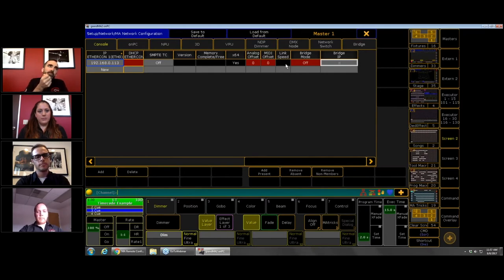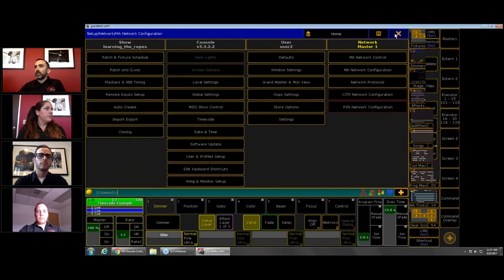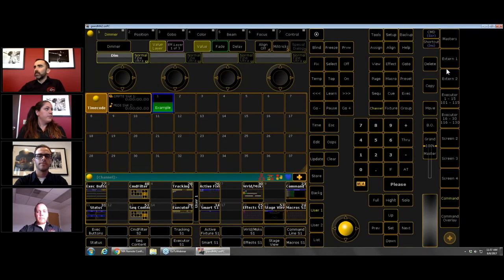If there is a port on the Ethernet switch plugged into a device that is gigabit, take the console and plug it into that port. If it's still not working, then maybe you have a hardware failure on your console. What if someone set that port to run at 100? It's pretty rare, I would think. But are you talking about the command?